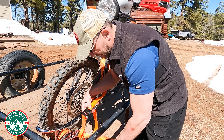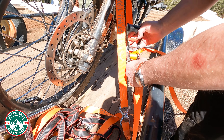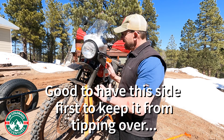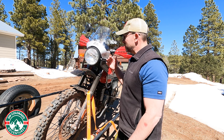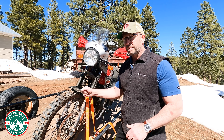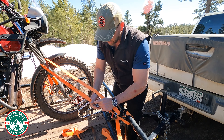If your trailer doesn't have built-in tie-downs, when you buy your chocks you can get ones that mount through the floor. Clip the two hooks together. Now I'm not going to tighten this side down yet — you always want to start with the side opposite the kickstand, so the right side of the motorcycle. That's what's going to bring the bike up perpendicular to the trailer. Once you've got that, come over to the other side. Don't over-tighten, because if you pull it too far that direction with no kickstand, it's going to fall over. Get it snugged up and cinch both sides back and forth to maintain that perpendicular position.